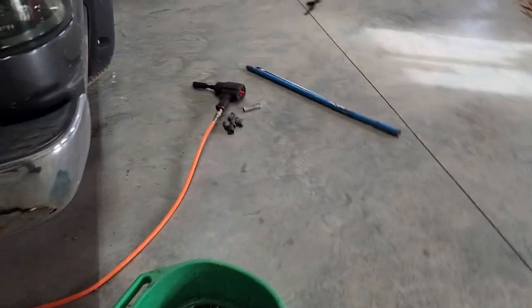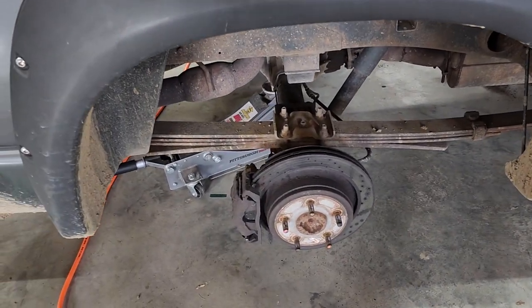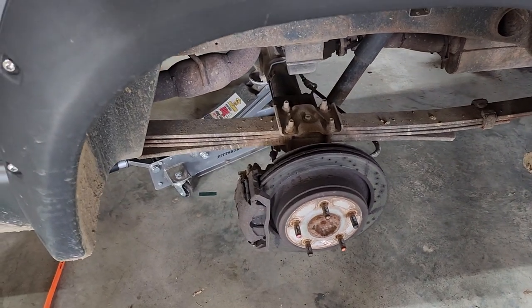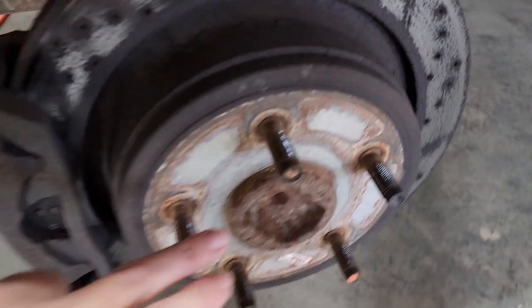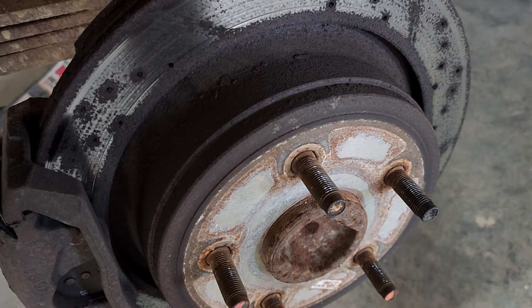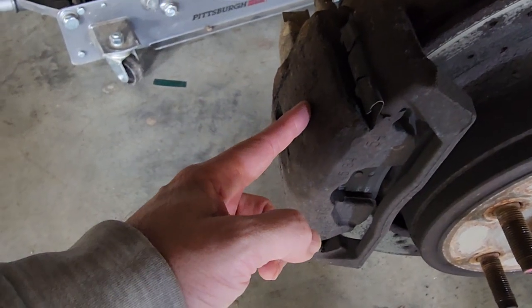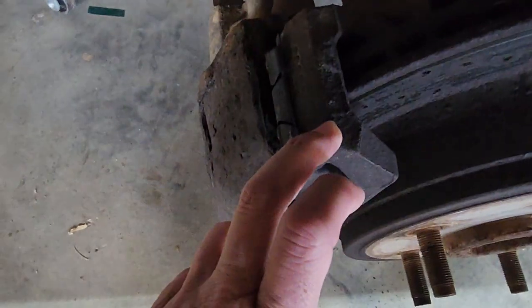This is the passenger side — I've already done the driver side. I got new rotors just because I was back here and these are looking pretty worn, so I went ahead and got new rotors. I took that off and then inside this section, if you didn't know, there's brake shoes for your emergency brake. To get to that you have to take off the caliper itself, which is 10 millimeter bolts — one here, one here, and one down underneath. Take that off and it'll leave your bracket.